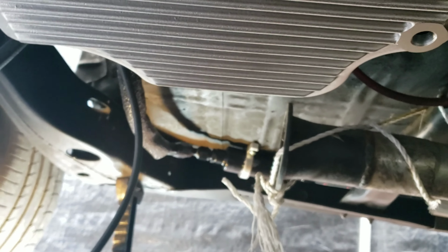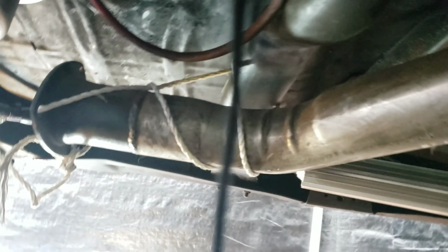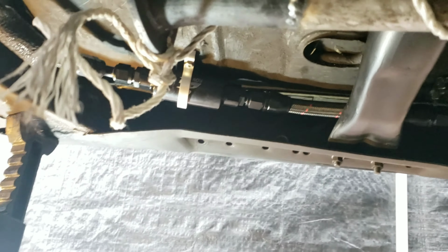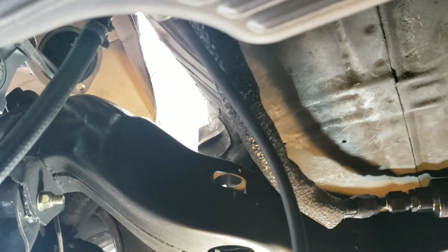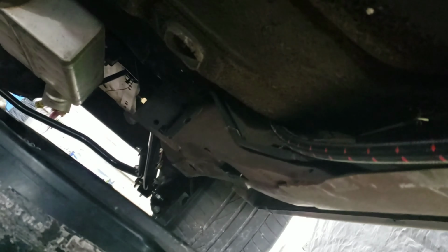You see the fuel. I made the lines basically just for the feed and the little split, which I don't think you can see. Oh yeah, there's a split from the filter. Still gotta mount the filter. It's not tight. I'm leaving all the lines for all the fuel loose until I get the fuel tank in, just so I don't forget. That way I can go over it all. I'm gonna retighten everything before I actually take it out. So it's just what I do for all my builds. So here's a return. Again, I still have to mount them all in there, but I don't want to do that till the tank's in and the line's made.